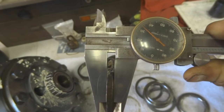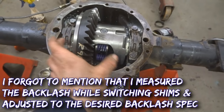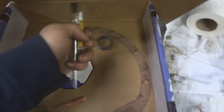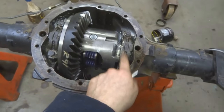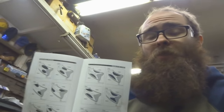I have about a 235 shim on the right side and a 200 shim on the left side. I originally started with 200 on each side but it seemed like the pinion was too close - the way it sounded just seemed like it was a little too close to the ring gear. So I took a little out of this side and now it seems more appropriate. Now that it's approximately close, I'm going to take some lead paint, which comes with the Yukon kit. The pinion is already set with the crush sleeve - everything's good to go. I'll take the lead paint and cover about a quarter to a third of the total gear surface on both sides. Cap bolts are torqued to 60 pounds as spec says. You want to make sure when you torque them that you torque evenly and that the gear still spins on its own and isn't feeling chunky.